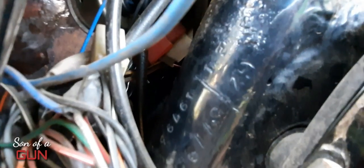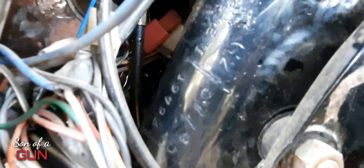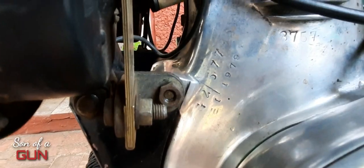The set of serial numbers on the engine and frame should be similar for an original motorcycle. I hope you are all aware as to where these serials have been punched. Tilt the handlebar to the right and there you will see the frame serial on the neck. The engine serial can be found on the left side of the crankcase, at an angle between the drive cover and the engine breather.